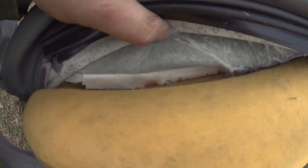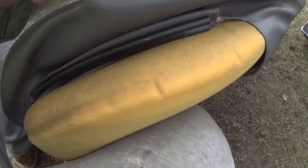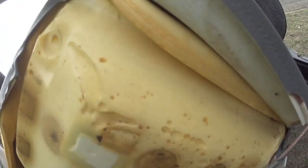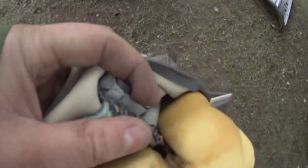This cushion is now obviously tied to this. Oh, this seat looks pretty tasty. So if you can see in there, there's a hog ring securing that cover cushion, which has got, the cushion's got like rods molded into it, like welding rods if you like. So it's just a case, when you've got more than one hand, of peeling it off and then undoing these one by one. Okay.